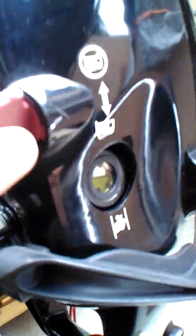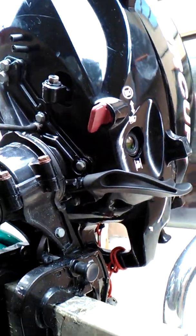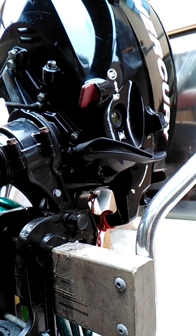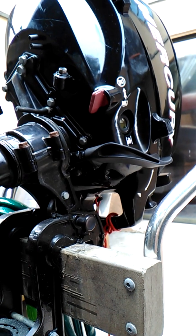Had to replace this little valve here, which it did not have, so I ordered the parts for that. Now that works — it's a fuel on and off valve, so you don't have to continually pull the cowl off to turn your fuel return on and off.